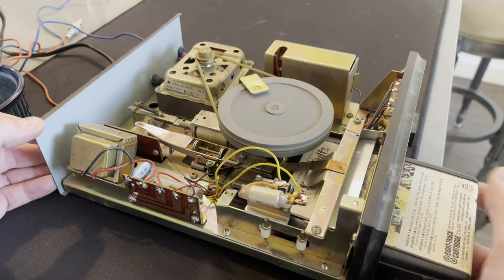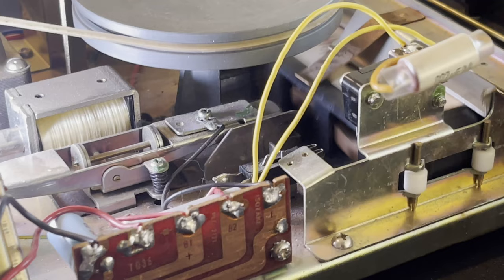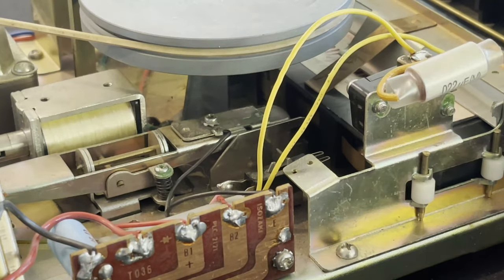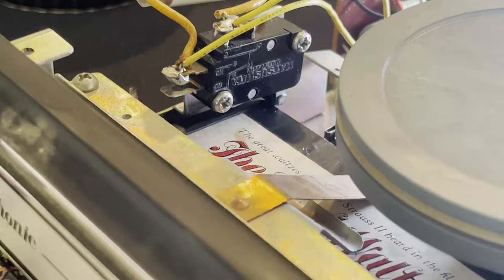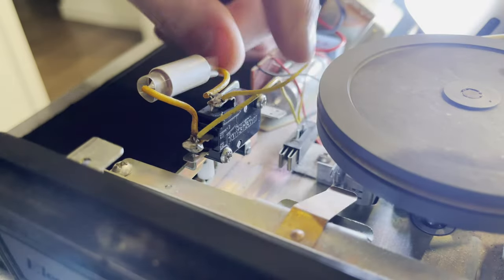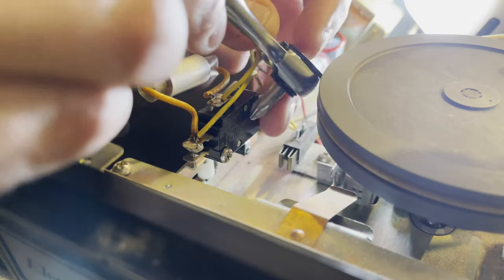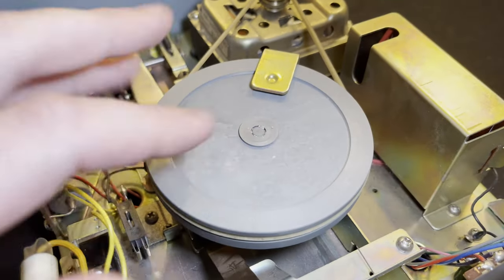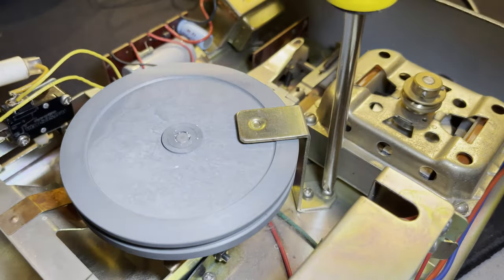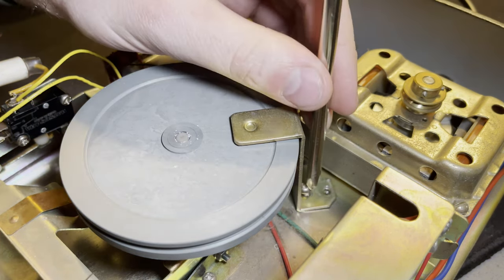We got the case off so we can have a better look at what's going on. It's not making that bad vibration anymore, but we can see the cartridge just isn't fully seating - something's holding it up. And it appears to be the switch. It can't get past the switch. I'm gonna try to remove it, but I can't get to it because this big flywheel is in the way, so I gotta remove the flywheel. This is what the motor's connected to. It's an incredibly simple device inside - just a motor, the flywheel, and then the flywheel has a spindle coming off of it that drives the tape.